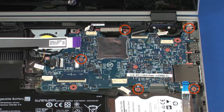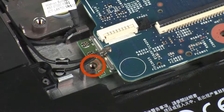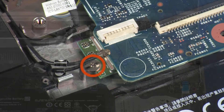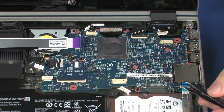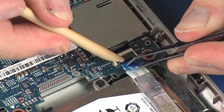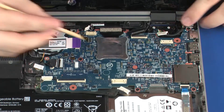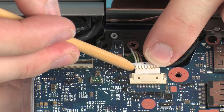Replace the five 4 mm P1 Phillips-head screws that secure the system board to the base enclosure. Replace the 2 mm P1 Phillips-head screw that secures the wireless module to the base enclosure. Insert the hard disk drive ribbon cable into the hard disk drive ZIF connector on the system board and press the locking bar down to lock the cable into place. CAUTION! Use care to prevent damaging the ZIF connector and ribbon cable. Connect the power connector cable into its connector on the system board.